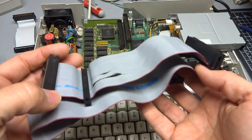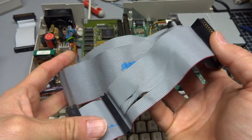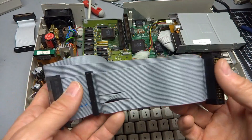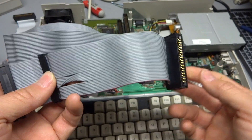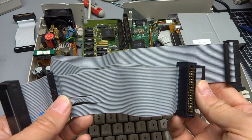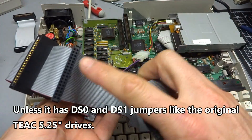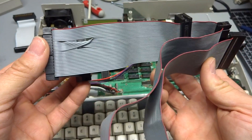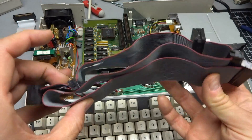Some people say that whether you're at DS1 or DS0 it doesn't matter because the twist in the cable allows you to use a drive on either setting, but that's not correct. What I found was happening is if I put this drive in the computer configured for DS1 and used the floppy cable on either the twist or the straight-through connector, neither actually worked. The motor would turn on but it would not do anything at all. All PC floppy drives are configured for DS1, which is basically the B drive. That's why when you have a straight-through cable and connect a DS1 drive, it shows up as the B drive. To get it to work as the A drive you have to connect it after the twist — but this is actually a non-standard, proprietary PC approach that doesn't follow the actual interface standard these drives are based on.